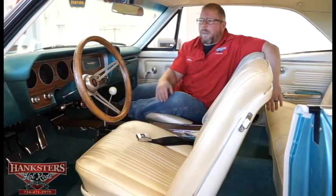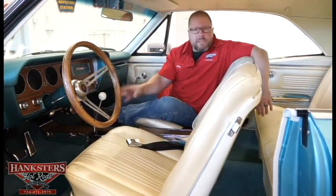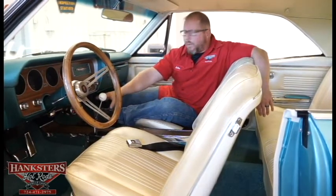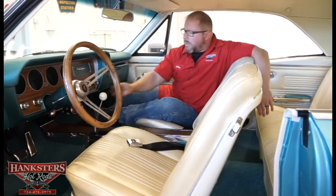One would be either they just don't read too accurately, which I believe on this car they are just a warning light, so you actually can't just see a good reading per se on those gauges. So they go ahead and install these gauges. That way you've got an actual reading to go by. So it just allows you to monitor your engine a lot closer.